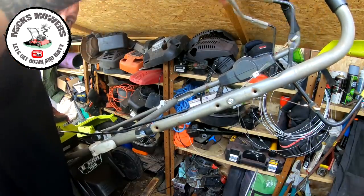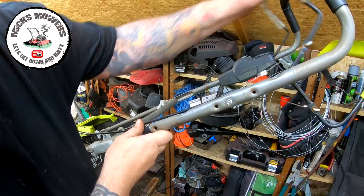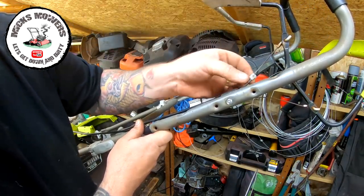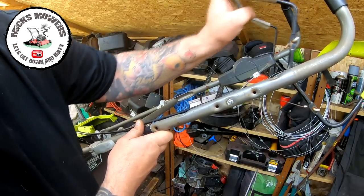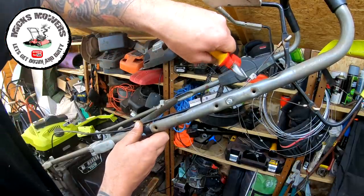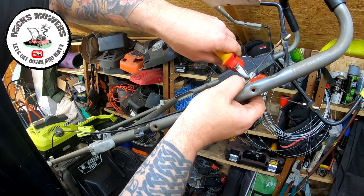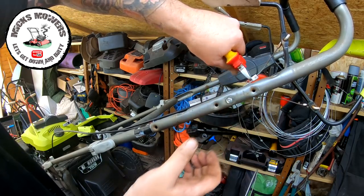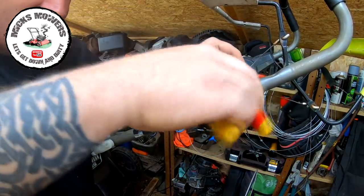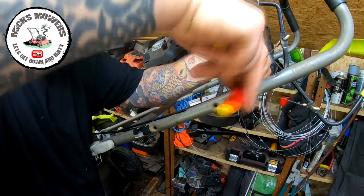And as you see, that cable is now not moving. So my advice to you guys who are using that little hack is to fully crush that completely flat in a vise. Seems to work really, really well. The drive ones are particularly hard, they take up more tension. But I'll snip that other cable if I can help it. They tend to pull out to a degree, but if you crush them in a vise, then you'll find that it doesn't.